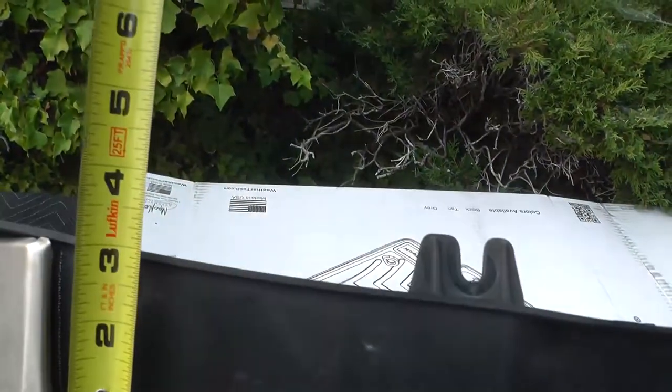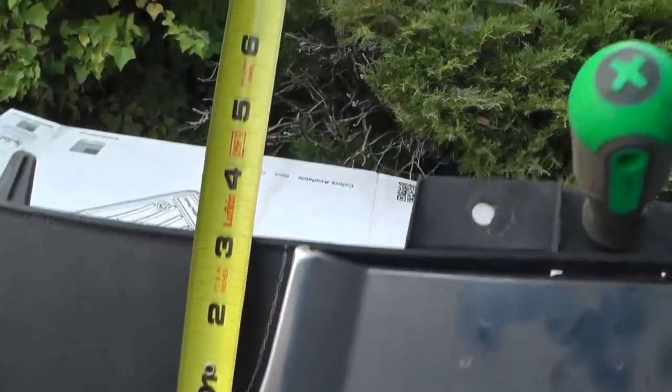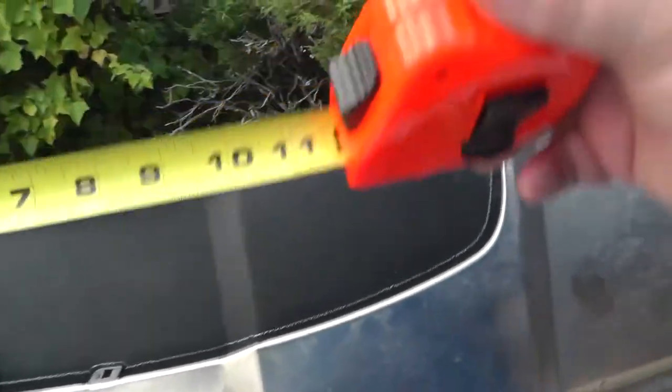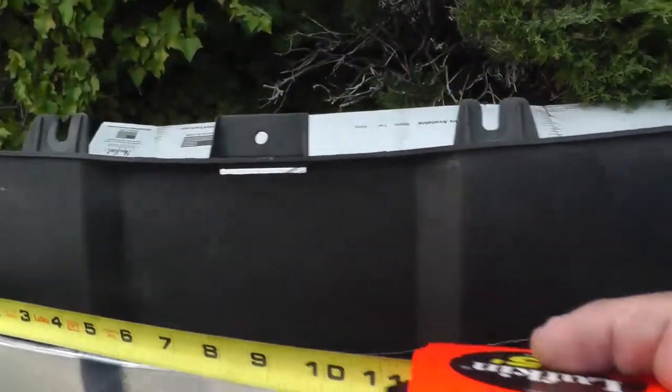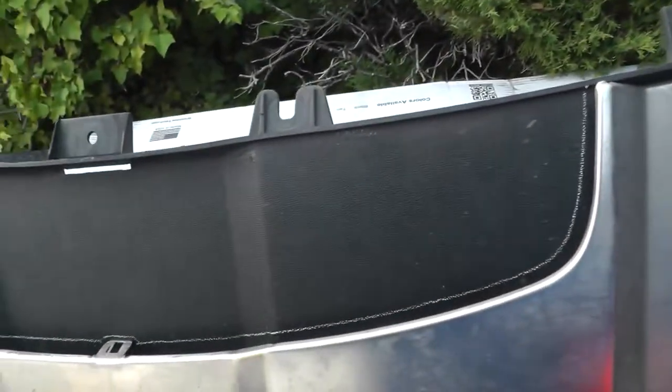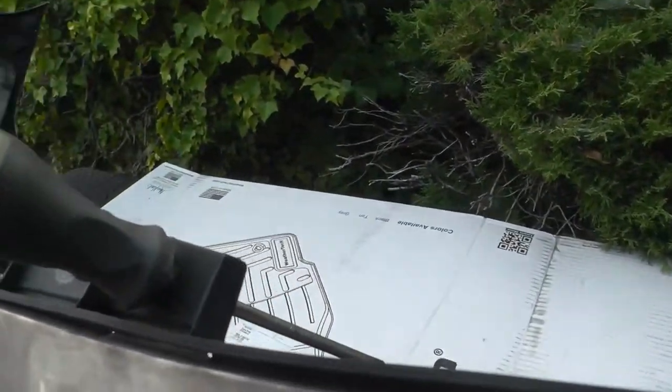And here at the shallower corners, the depth from there to the edge is about 3 inches. So since this is 22 across, it's sort of 11 inches out from here, 11 inches out from there, down 3, down 3, down 5, and you're sort of marking that curve. So I'm going to go ahead and cut this with an appropriate tool, and then I'll fit the metal. The reason I knew I had good alignment here is there's actually slots here where the metal goes through the plastic at various points, and I've got a screwdriver stuck through the screw hole to make sure I maintain alignment.